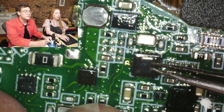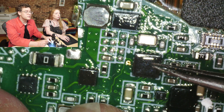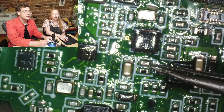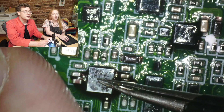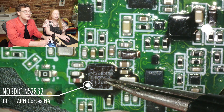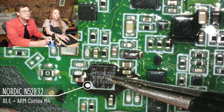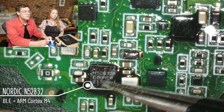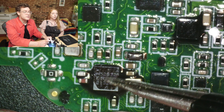The main microcontroller — it's the shiny one — reads N52. That sounds like a Nordic 52 series. That's the Bluetooth module and ARM Cortex-M4. So this will be the main microcontroller: it's got Bluetooth and also has a Cortex-M4 inside. And here's the clock for it — here's the crystal. There's two clocks right near it.